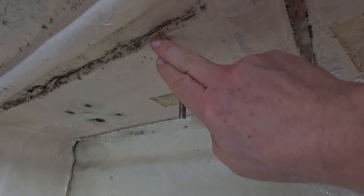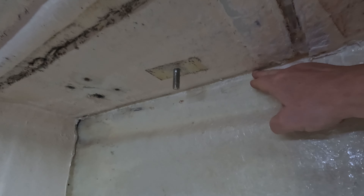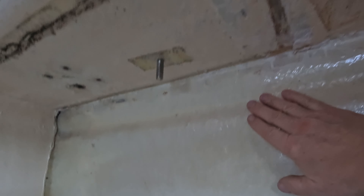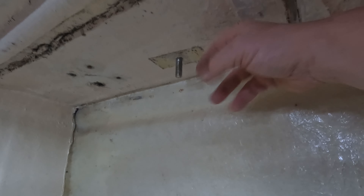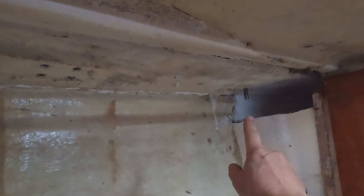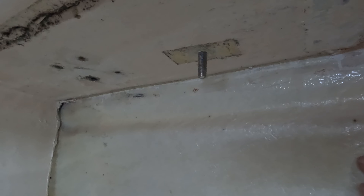Scenes of devastation in our cabin, but what we have achieved is - that's where our first backing plate is going to go. There is the middle one for the cap shroud which goes through that slot and sits nicely, and here is the one for the forward lower which again goes through that slot into the forward heads. So we've cut the holes large enough to fit the backing plate and the slot for the chain plate loop.